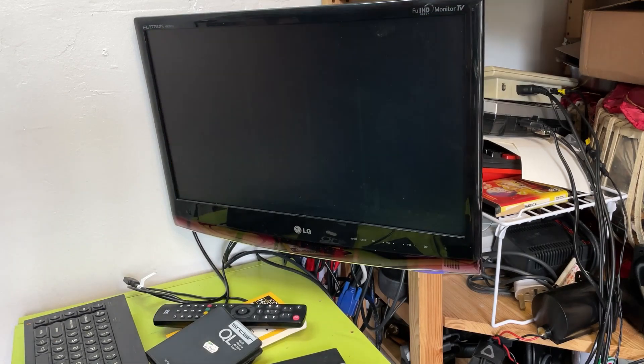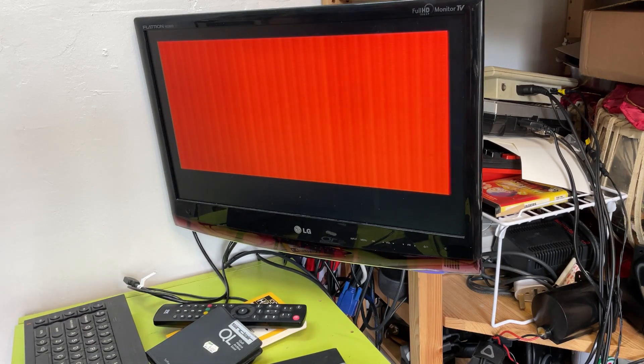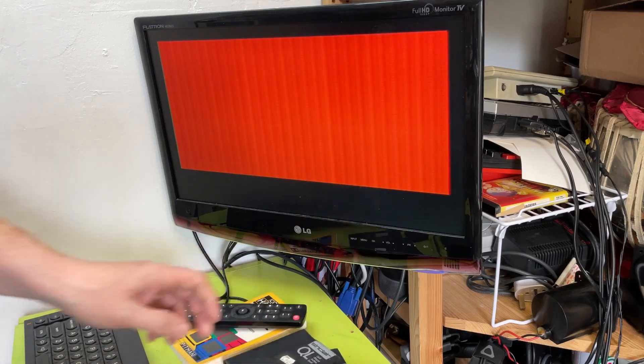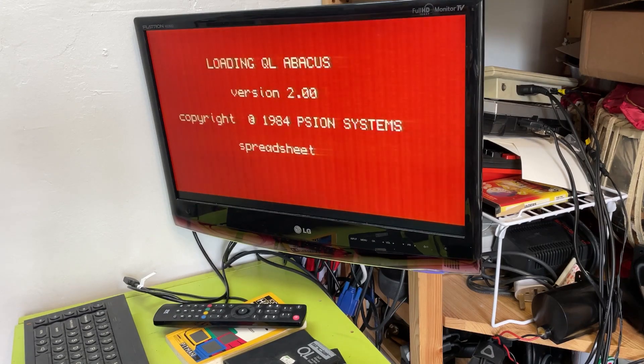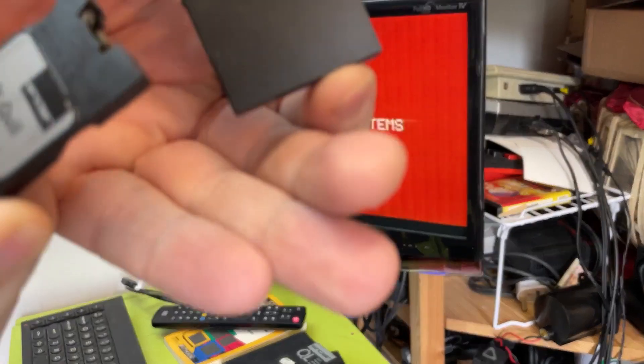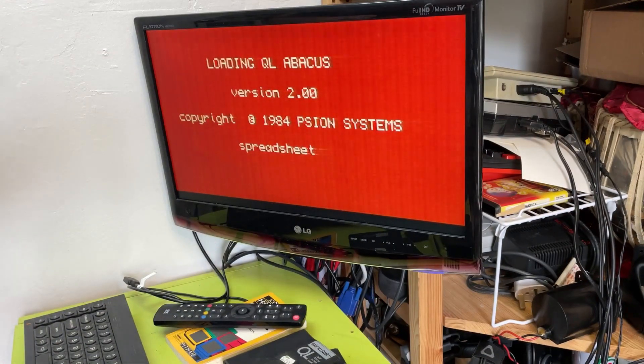So that's got one, so that may work. The micro drive itself is possibly working - it's just that the cartridges are worn out. I wonder whether it's possible to dismantle these things and put a little pad in, similar to the stuff that's in ordinary cassettes. Well, that's great that it loaded something - at least we're getting some response. I did clean the heads before and the capstans looked okay. That's the right result. The component that wears out is that pad - as the tape flies past it's pushing against the head but it will eventually just wear away, and worst case it can disintegrate.